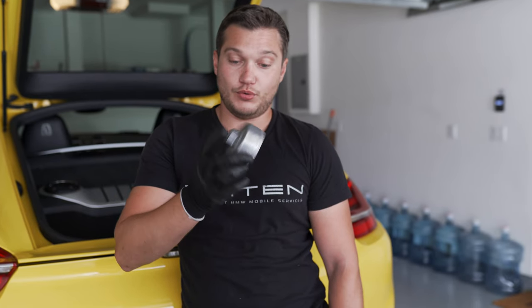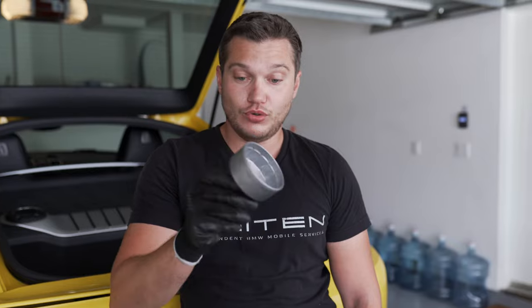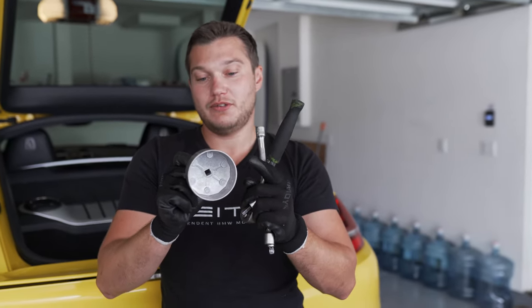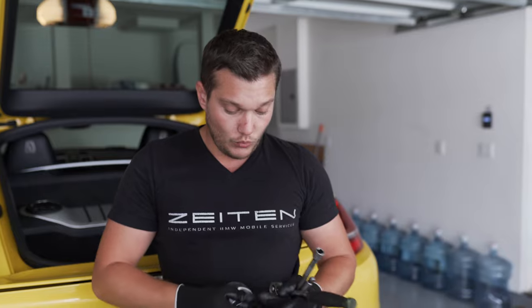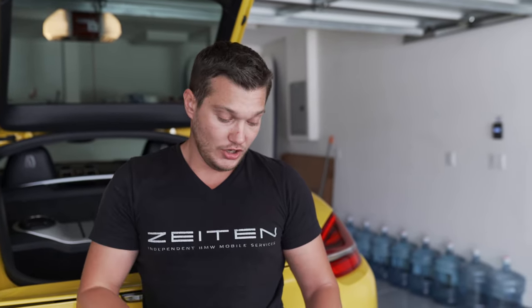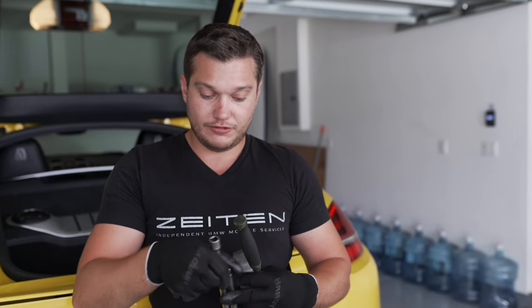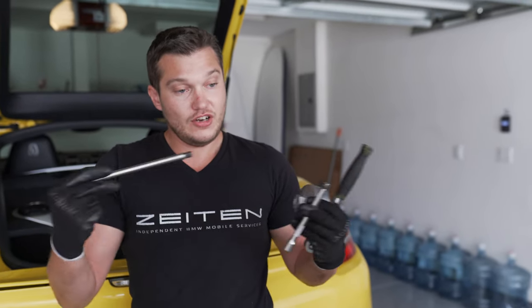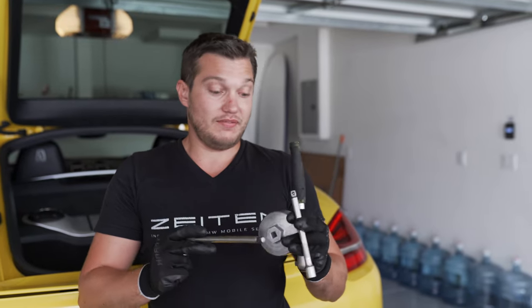What are we going to need for this oil change? First of all, the oil filter tool — it looks like this. I have exactly the same one for the BMW, but the diameter of the cap is bigger on the BMW, like 86 millimeters, and this one is 74.4mm. We'll need that — 12 point, as far as I remember. We'll also need an 8mm Allen key socket for the drain plug, and maybe one or two extensions for the filter since it's kind of deep inside. And of course, your oil pan to collect all the oil.